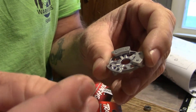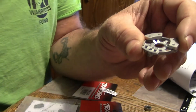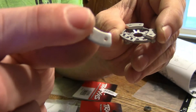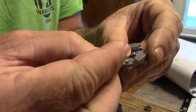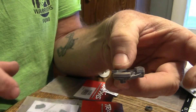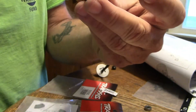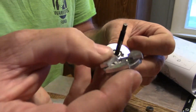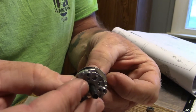These are aluminum pads. In the 5352R kit, the aluminum pads have one side rounded and the other side flat - you want the flat side up. Put those on, and if you're not using those then you're using the regular slipper clutch pads - it's pretty much the same thing. Next you're going to take that assembly with the clutch pads you just put together and slide it on with the pads facing towards the steel plate.